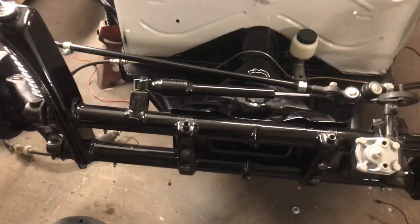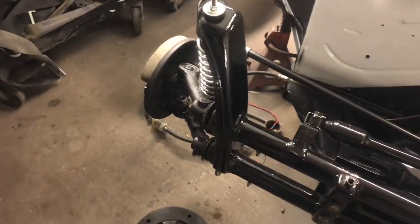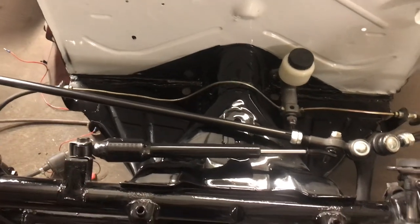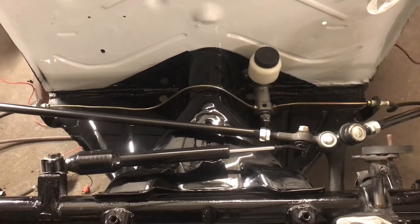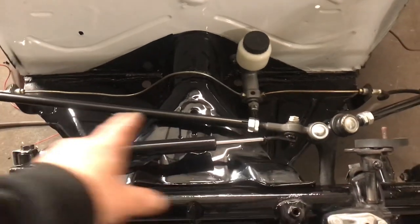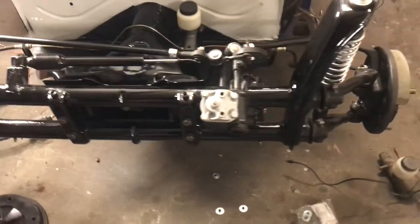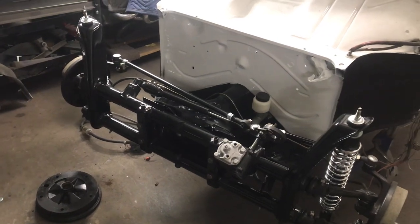Here's the Baja project. I had to cut the bulkhead off this, welded a ball joint bulkhead on here, and rebuilt the beam. I got some new ball joints in there, all new brakes, painted the backing plates and everything really nice. We went with the regular brake setup because of all the expense of changing it over. He couldn't find anybody to do his kingpins and spindles, so he decided to go the ball joint route. I just cut the old bulkhead off, welded a ball joint bulkhead on, made some clean brake lines, and got new tie rods, a new steering dampener, new shocks, and a used steering box that I cleaned up.